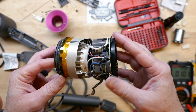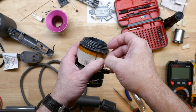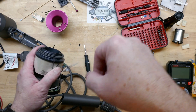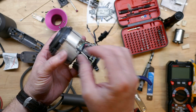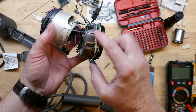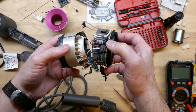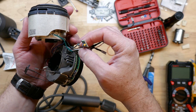Now let's focus on the actual Dyson head unit itself. Let's go ahead and take off the Kapton tape so we can take the front of this off and give it a good inspection. There's our NTC thermistor, and there is the high-voltage ionizer — as shown in the previous repair video. This white wire is a high-voltage wire that goes to a module putting out up to 3,000 volts to ionize the air coming across the dryer.